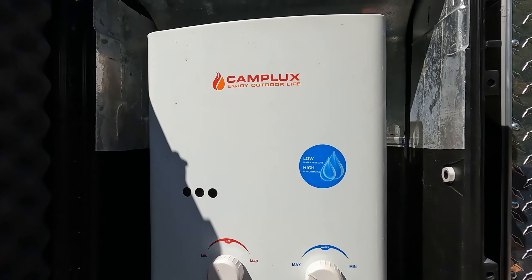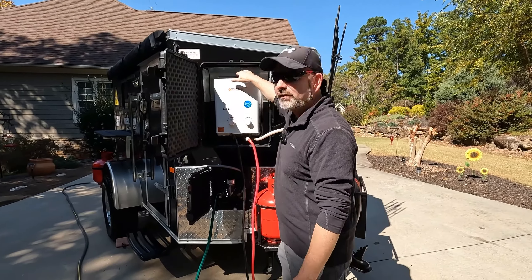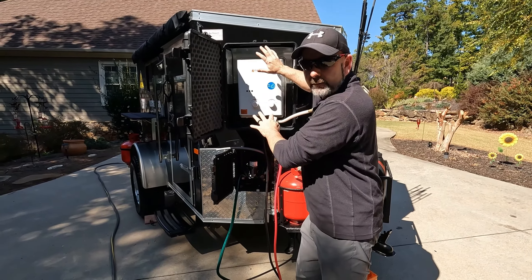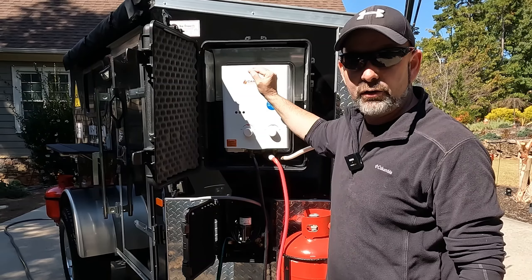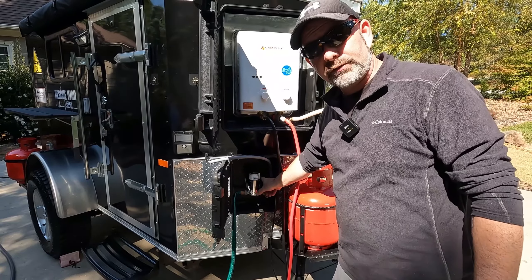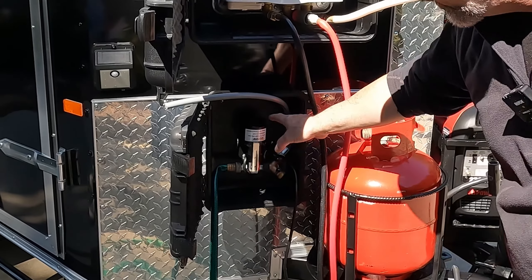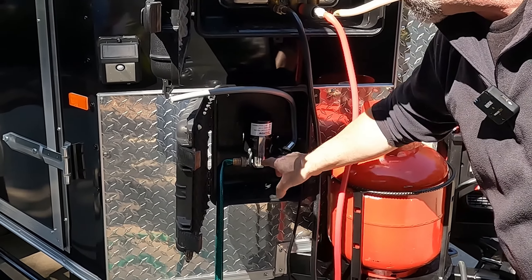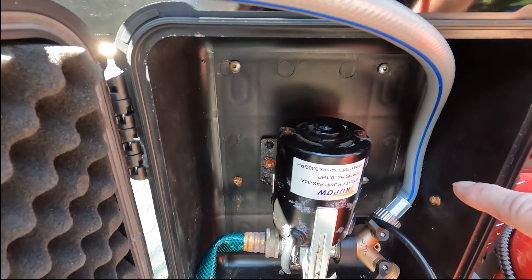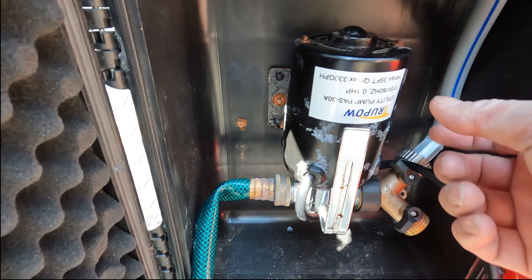But before you do that, you have to put butyl tape on the back so that it will keep everything together. As you mount this with your self-tapping sheet metal screws on the top and bottom, that's what secures it to the camper. Don't forget to put butyl tape in where it's going through because that keeps it sealed so it won't leak into the camper. For the water pump, I pre-drilled some holes where it was going to mount to the plastic, put those bolts in from behind, pre-drilled where the stud was, and mounted the plastic box to the studs with self-tapping sheet metal screws. Then I had bolts sticking out to mount the pump onto and tighten with a wrench.